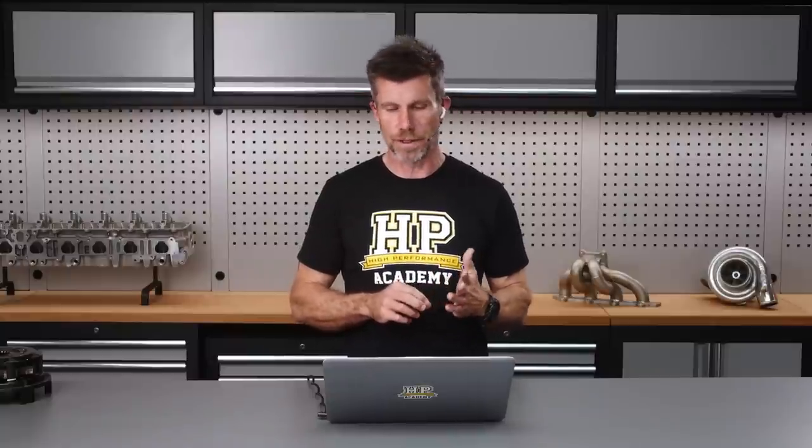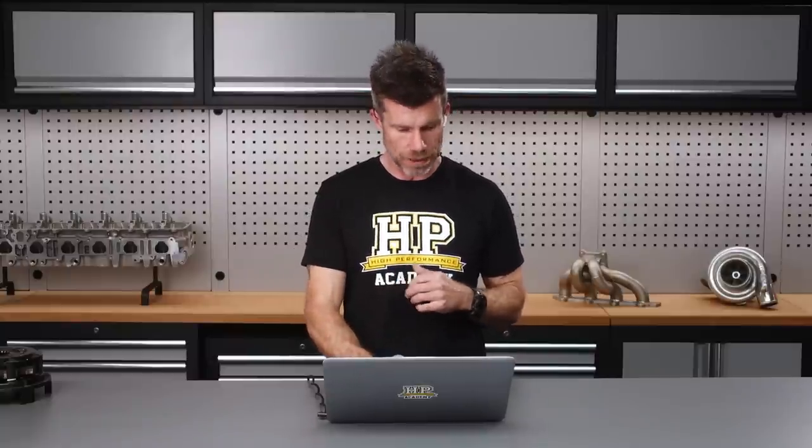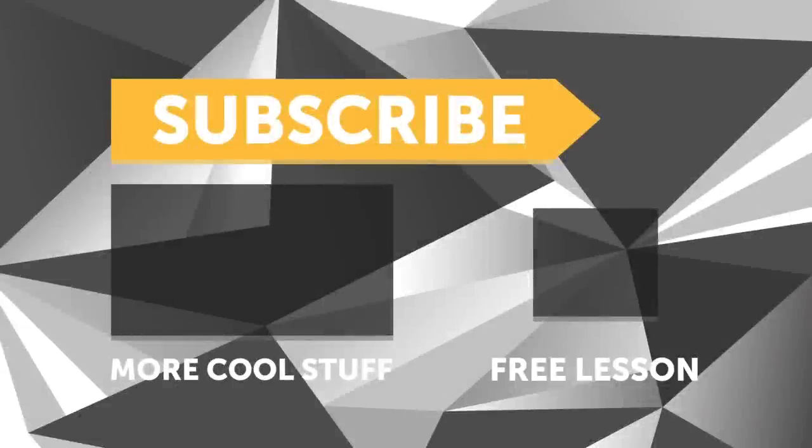This can offer sometimes relatively significant improvements in performance, depending on what the existing mixture preparation is like per cylinder. When tuning conventionally with one single lambda sensor mounted after the collector, we're getting a report on the average air-fuel ratio of all cylinders. We could have one or two cylinders running a touch lean and one or two a touch rich — they even out and the reported lambda looks on target. As we push closer to the ragged edge with our tuning, that can be enough to potentially damage cylinders running a little lean. Getting the air-fuel ratio equalised across all cylinders can also offer performance benefits. We'll report back and see how we get on. If you liked the video, give it a thumbs up, subscribe — we release a new video every week — and click the link in the description to claim your free spot to our next live lesson.